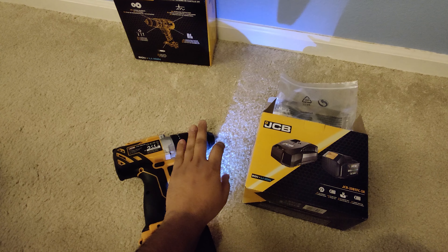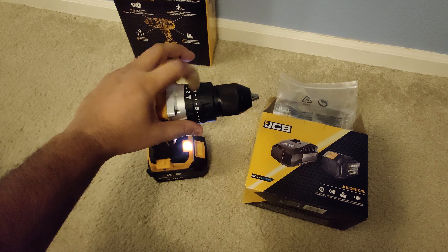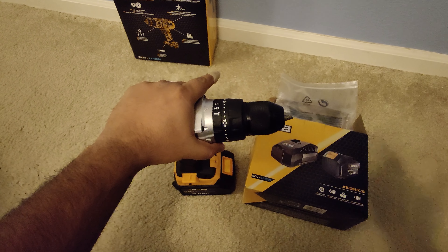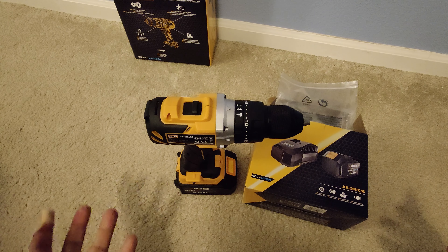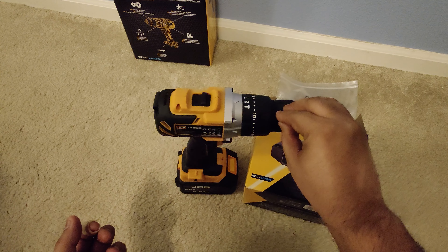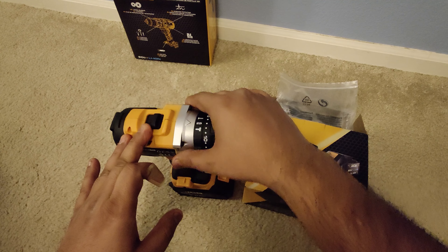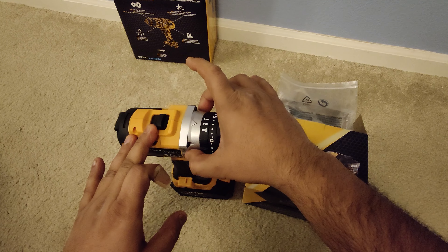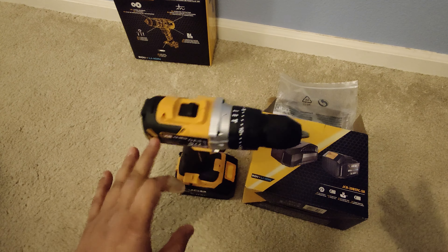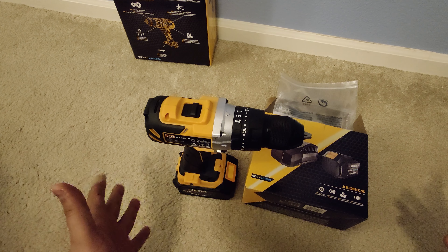It was a little tricky because I was not able to remove the chuck, so it wasn't as straightforward as you'd think. I had to put all those notches upward with the spring, and the mechanism that makes that noise was a very small piece — very hard. If you can remove the chuck, that would be the easiest way. The way I did it: remove the pan, then the metal pieces, get to the assembly, and there are two hidden screws — you remove both and it finally opens. You can review my previous video to see how to open it.